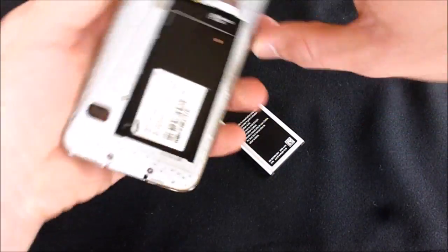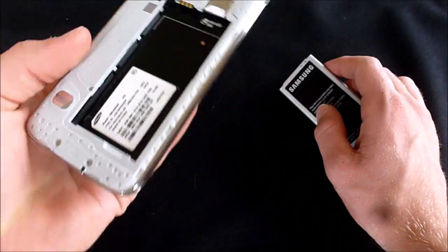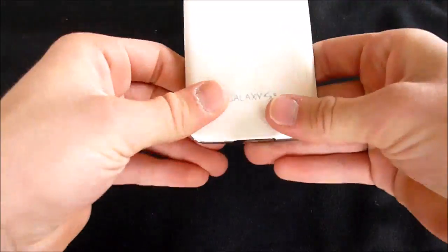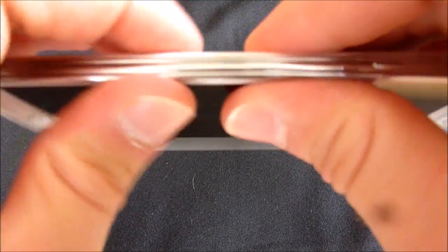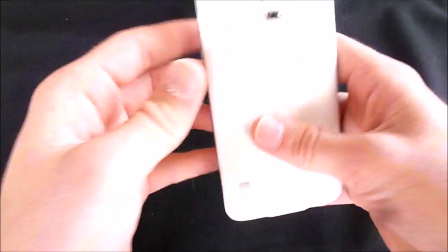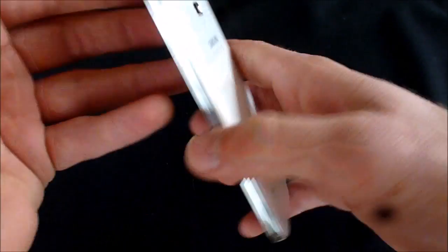This is the NFC antenna, so you need to make sure it's sealed when you put it in water. Here's the rest of the phone inside, and there's the SIM card slot for LTE. When you put on the cover you need to make sure you get all the points — push really hard around all the edges, because even when it feels like it should be on all the way, sometimes it's not. I'm not putting this underwater now; I might wait for the review.